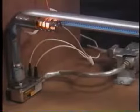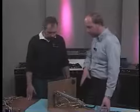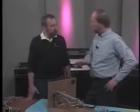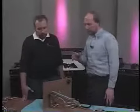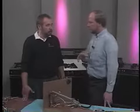What else should a technician look for as far as problems on this thing? Well, we already talked about the shutoff valve. That's probably the most common problem. I guess the most common thing they see is glow bar won't glow. Sometimes you can look at the glow bar and see where it's broken, and obviously you need to replace it. If it doesn't glow at all, it's obviously bad or some connection to that. Well, it's not necessarily bad, but if you can see physical damage to it, then you know it's bad.